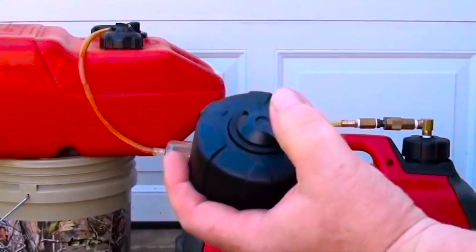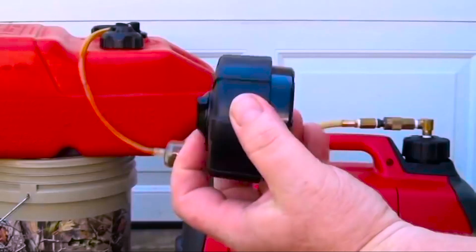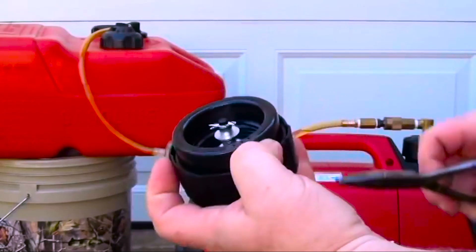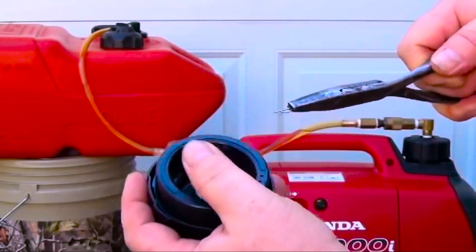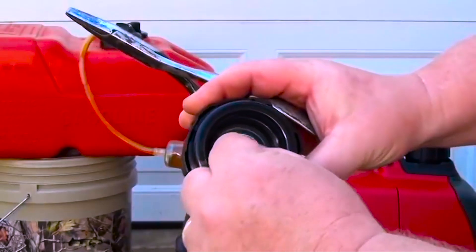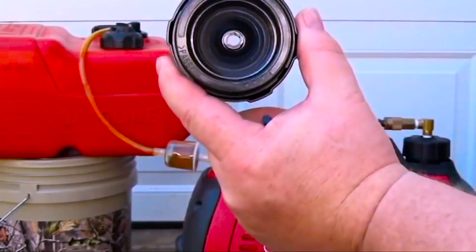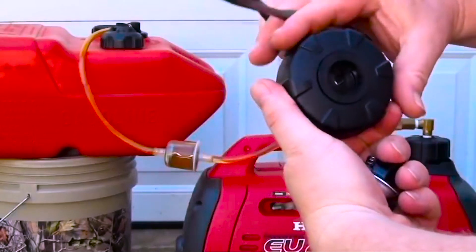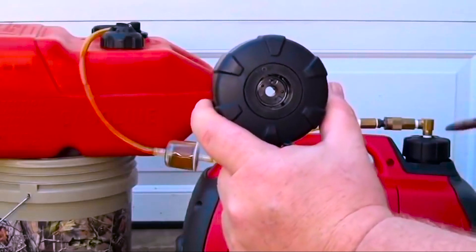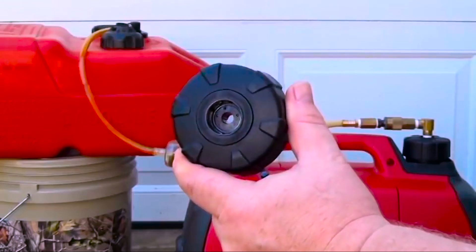The way you connect a brass fitting to the top of your stock fuel cap — that's the vent, the vent dial off and on. If you turn it over to start, you're going to pull the pin, and that releases all the components on the inside. There's the cap, spring, and then there's the diaphragm. Pull all that out and then you find the hole. All you've got to do is drill out that center to slightly smaller than the size of the brass fitting that you're putting in, and just thread it down in.